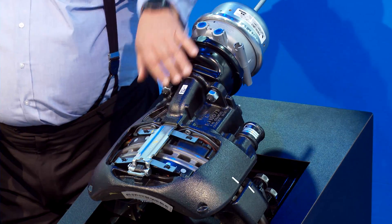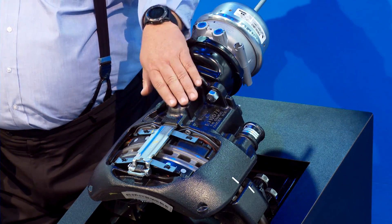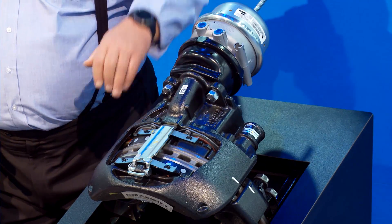The thing about our air disc brake is there's no grease fittings, so we're not greasing them. You can't measure brake stroke because the chamber is attached to the caliper and it's internal. What you can do is look at the caliper and make sure it moves in and out. That's a key point. Like any other caliper, if it doesn't free float and it hangs up, it's not going to work properly. So part of your maintenance is the movement of the caliper.